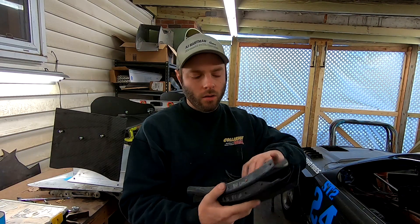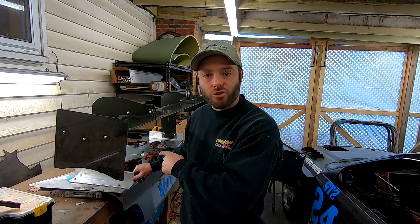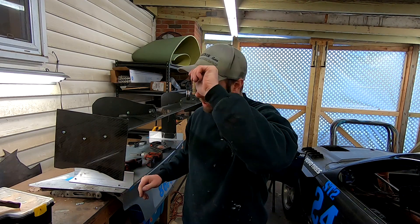We got our canards ready to go. Our Apex 8 is mounted and ready to go, along with our Fulcrum 14. The competitor wing we're going to mock up off camera. One thing worth noting is how I mounted this wing — do not do this if your car will be on track at all. This is just a quick mock-up for the wind tunnel. The wind tunnel only sees about 80 or 85 miles per hour wind speed, and we're only doing 0 and 5 degrees. Remember that downforce is exponential, so on track your wing will see a lot more forces than it will at the wind tunnel. The wind tunnel takes measurements up to 80 mph and uses math to extrapolate higher — that's why we can give you numbers for 100, 120, or 150 miles an hour.